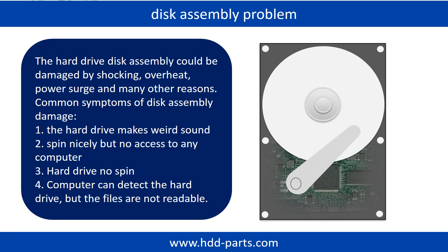If the storage is configured as mirrored hard drives, you can take the bad hard drive out, then put a same-size or bigger hard drive into the bay, and the storage will mirror the data to the new hard drive automatically. If this trick doesn't work, that means the two mirrored hard drives are both damaged, or the storage was configured as RAID 0, meaning the two hard drives work differently.